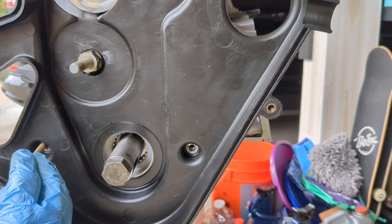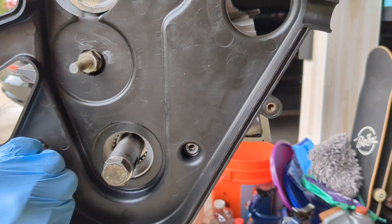The longest of the bolts also secures the rear timing cover. I wasn't able to torque down these bolts without the cover, so I temporarily installed it so I could torque down the bolts and allow the sealant to cure.